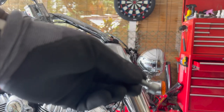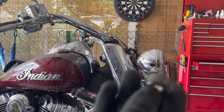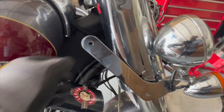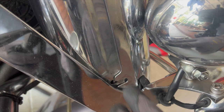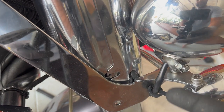Make sure to collect all the washers and spacers — don't let them fall off. Pay attention to what order they are when you take them out. I've got the four bolts removed. There's a rubber grommet here that's holding the wires in place — one on this side, one on that side — so make sure you remove that so the wires come out. Keep them handy because you'll need them on reinstall.